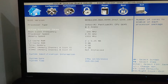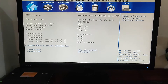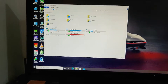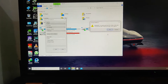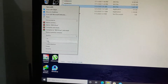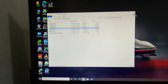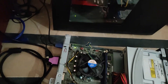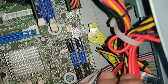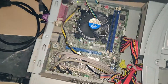BIOS version 99 successfully installed. Remember: after installing this version your computer will restart 2 to 3 times — don't worry, just wait. Now let's flash the final version of the BIOS: BE120 (2013). Format the USB stick once again, copy the final BIOS file BE120 into the USB stick. After copying, attach it to the H61 and remove the BIOS jumper. Remove the BIOS jumper, then power on and wait.